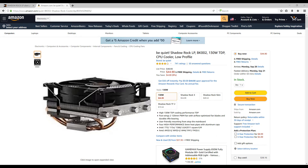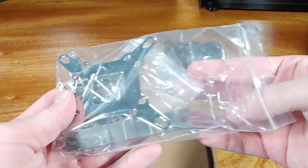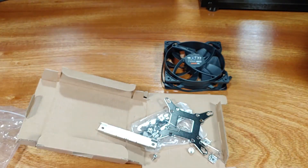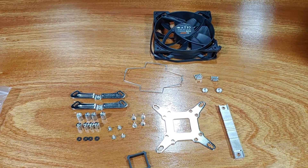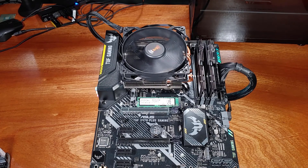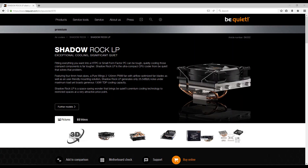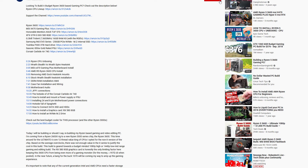The Shadow Rock LP comes in at around $45 on Amazon at the time of making this video, which is quite good value for a low-profile CPU cooler. The AMD mounting system uses the factory retention arms with screw-in clips, so definitely don't get rid of those. This is a more compact mounting method than Noctua's Secufirm 2 method, for example. The Shadow Rock LP is a well-designed and well-priced cooler that I would definitely recommend for anyone doing a small form factor build that can fit a 75mm CPU cooler, and depending on the case, it may also be a good match for somewhat larger ATX cases. Links to the cooler, build parts, and manufacturing specifications are in the description below.